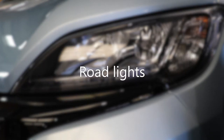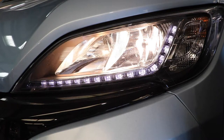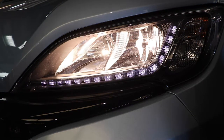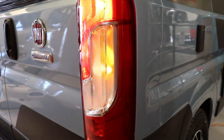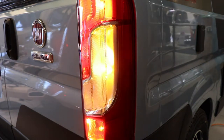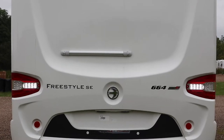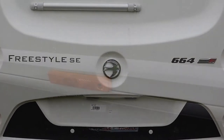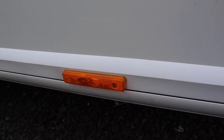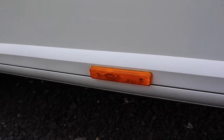With the engine running, switch on all the headlights, select side lights, indicators and fog lights, and test the brake lights. Check that all the bulbs, marker lights and light clusters are free from damage, have no condensation and are fully working. With the engine off, check the reversing lamp too. Don't forget to check the rear number plate light and the marker lights at the front and sides of the motorhome are also working. Replace any faulty bulbs.